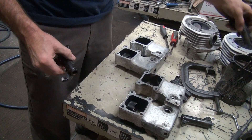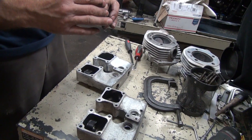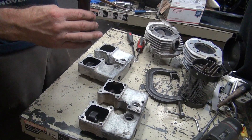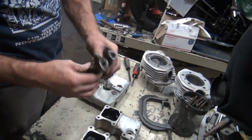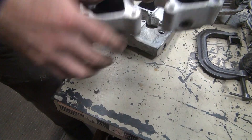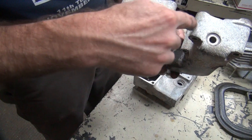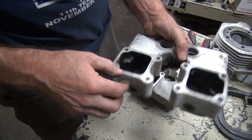But if we don't do it, it might make noise. If the bushings are loose, it'll sound like you've got loose valves all the time — click, click, click. And that's one of those noises that you can never trace. See the wear on the end of here? Now these are all apart, and you can see how much damage there is by banging these on the table — it almost knocks some of the corrosion off by doing that.